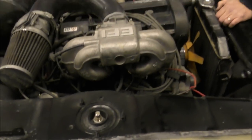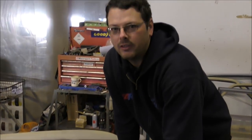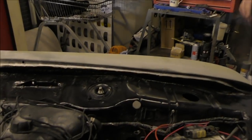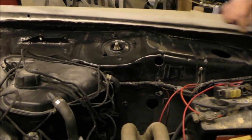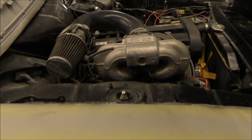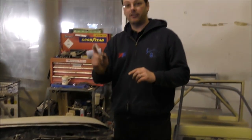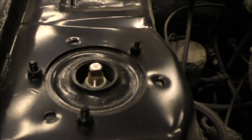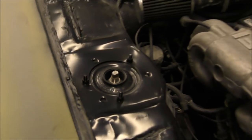What else did I do? Front suspension. The front suspension is slightly modified in that I couldn't find proper original inserts. Normally you'd buy a shock absorber insert that goes inside the suspension leg and bolts onto the top mount. I couldn't get them. Someone said why don't you get the original ones rebuilt, but I couldn't because somebody had cut the legs down and it had a nasty weld. So these are Volvo 240 inserts and Volvo 240 top mounts, so it's now got a rollable top mount and a slightly fatter damper inside.